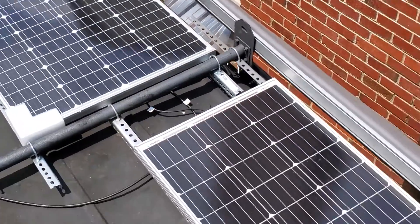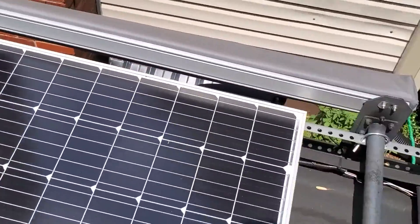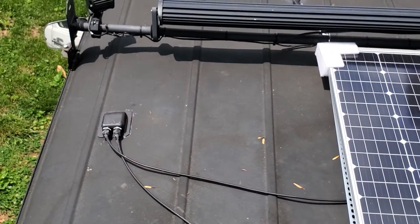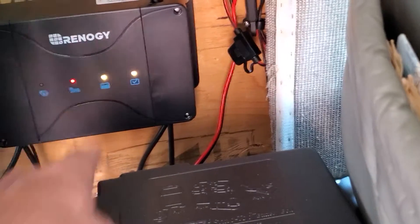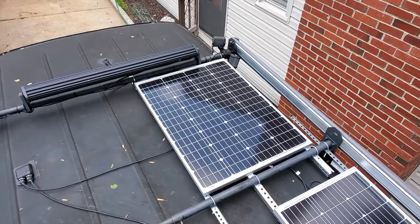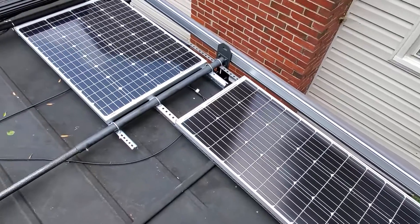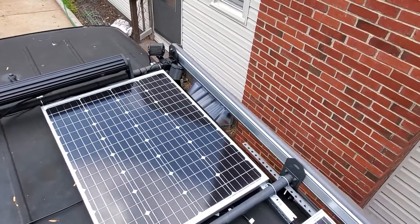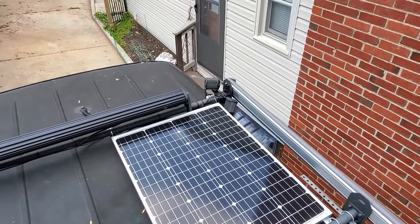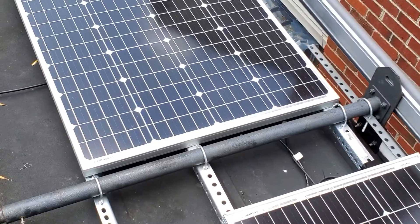I'll move this off so you can see the size difference — it's a little different. That one's shorter; that's why I got it to fit in between those crossbars, whereas this one has space, but I can still put my surfboards or my cargo box here. Looks like my solar panels are in fact correctly connected because the bulk charge light is on. Just like that, second 100-watt solar panel mounted. These are slightly different and I had to offset them a little bit. Unfortunately very few people ever see my roof, but I had lights and things there that had to be worked around — wasn't going to move those. So there you have it.